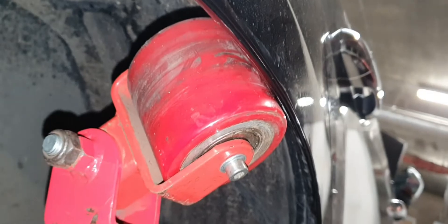I need to touch up my arches on the rear - the front is fine. The rear 295s are hard to fit. The arches are already rolled but I need to touch them up because this bit of plastic here is going to rub on a brand new tyre, so I'm going to push this and make it more flat.